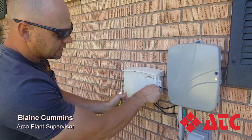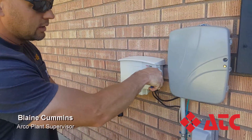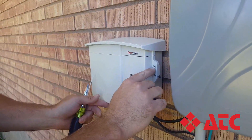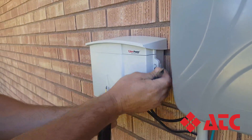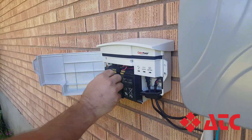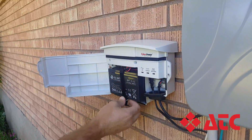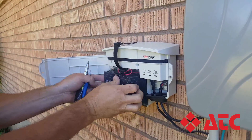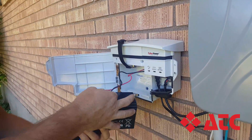The first thing you need to do is cut the existing zip tie on the CyberPower. There may be a screw in the top hole, but most likely not. Take the zip tie out, open the CyberPower, undo the velcro strap, and it'll come off the bottom latch. Pull out the battery and disconnect the leads.